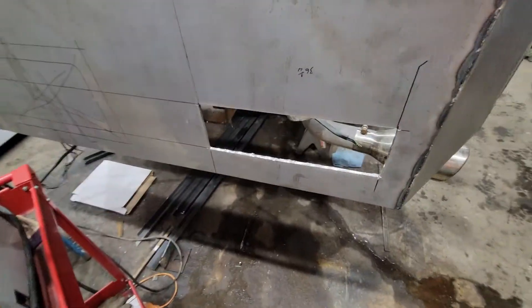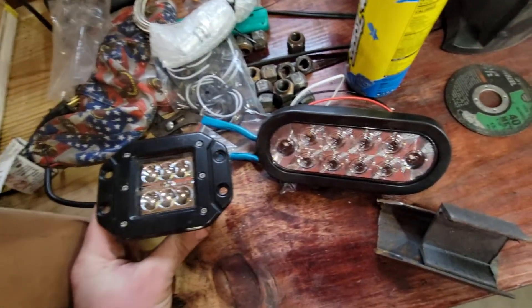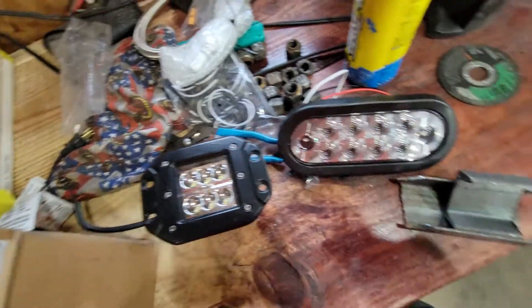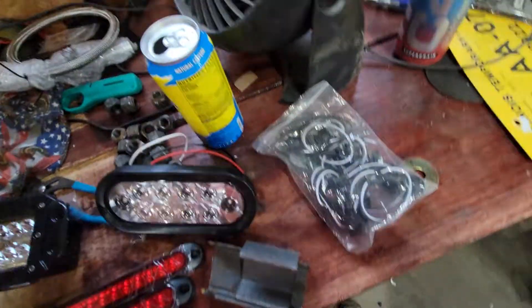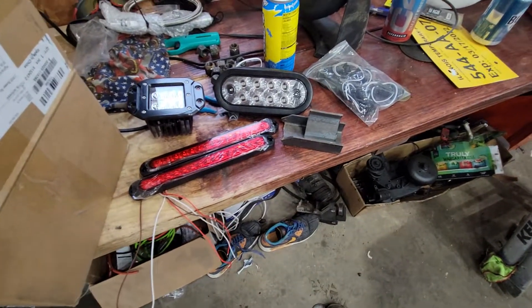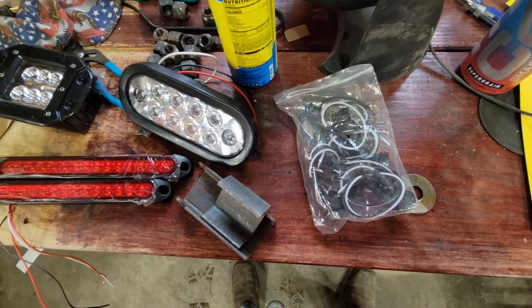For the lights — you see a lot of trailer lights they sell, but by the time you cut the pieces for them it looks kind of cheap. I cut out an oval with the plasma cutter — you can use a hole saw but they're kind of expensive. I think I'm just going to stack two lights up. For the 3/4 inch button lights, shop around Amazon and eBay — you're going to find them for about $4 apiece. I got almost 30 of them for about $20 off Amazon Prime.